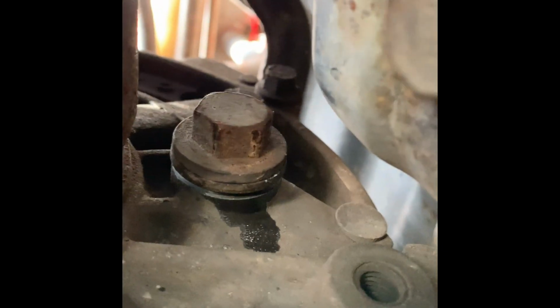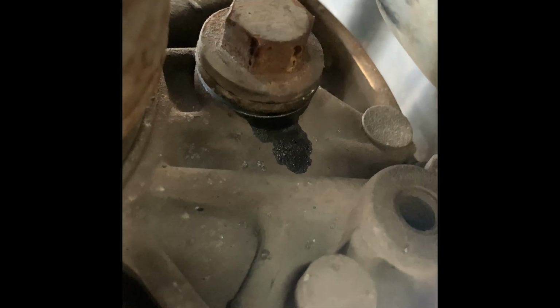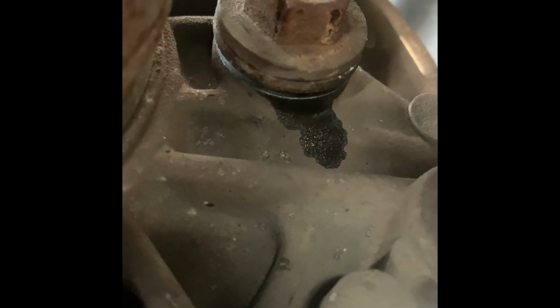Sorry, that's a couple of videos then because a really noisy car came. So from underneath the car, that's where you put the oil in, and that's where you drain it. A good guide with these for the correct level is, when you completely undo that, it should just be a little bit seeping out. I've not taken it out all the way yet, so I don't know what the level is.